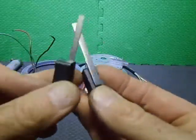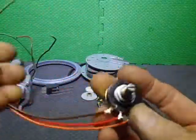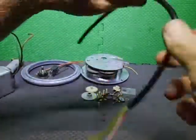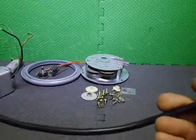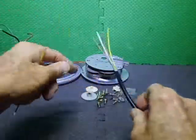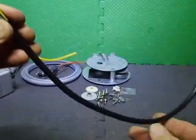I'll be putting brand spanking new limit switches in, brand spanking new potentiometer, and this is all brand new wiring - I'm rewiring the whole thing. The only original wiring will be the wiring coming out of the motor. This is all tin copper wire - trailer cable wire that's all tin copper. The yellow wires are for the limit switch return.